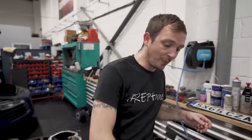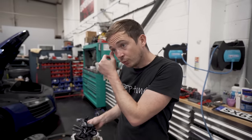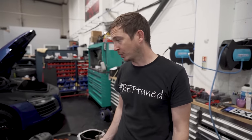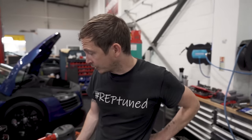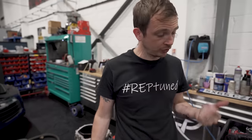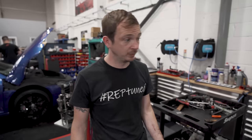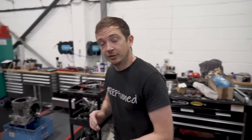Good job — come to us for all your gearbox needs. You know, people sort of go 'oh it's not that nice' — yeah it is. There's about four or five special tools you need, which you can make do without but they make life so much easier. We'll put four new bearings in, six new nuts, give everything a good wash, the casings need machining to put the needles in. Jobs are good — then put the gearbox back in, run the hose pipes, and that's it. You've earned yourself a tea break — until next time, see you later, subscribe.